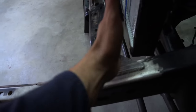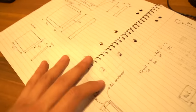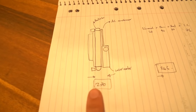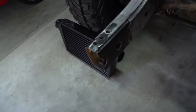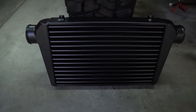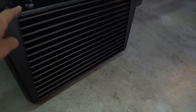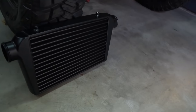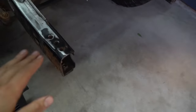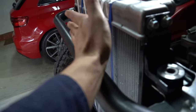I think I might be able to just squeeze the front mount intercooler in here and put a smaller AC condenser up the top. I'm a very visual person — I need to draw everything to understand. I've drawn out all my parts and how I think it's going to fit, and I think we're at 246mm with 270mm in front of the engine, so let's see if we can make it happen. The intercooler has lugs and this is an Aeroflow 300 by 450. Hot tip: when they quote the intercooler sizing, 300 is the actual height and 450 is the size of the fins — it's actually a bit longer than 450. I ordered a 600 by 300 and it wouldn't fit between the rails, whereas this one will, and dropping it down gives me a bit more space for an AC condenser up the top.